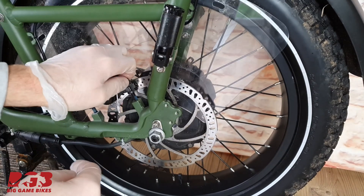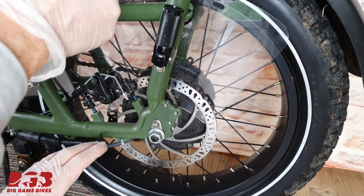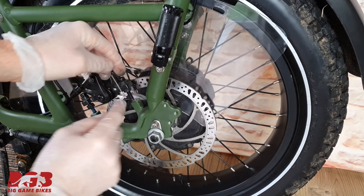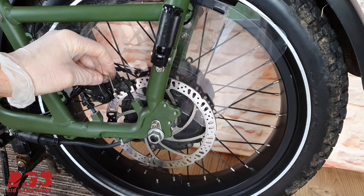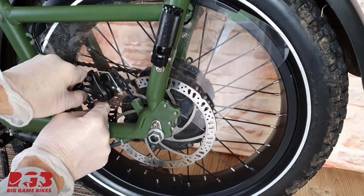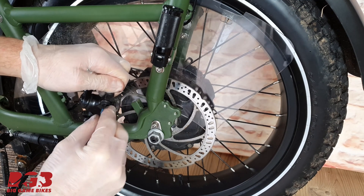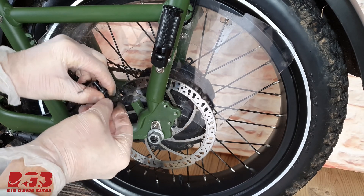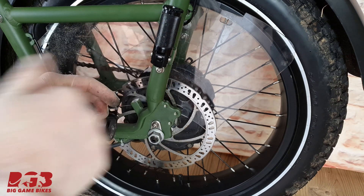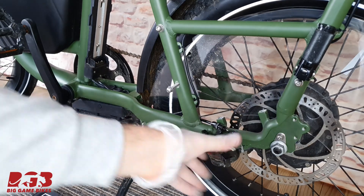I've removed the back panel just to make it a little bit easier to get into these four bolts. I've put some gloves on because this is a little bit of a dirty job. Now this is the really important bit — remember the washers? They need to come off the bicycle and go back onto the bicycle in exactly the same order. They're all holding together nicely, and that's the caliper off. Make sure you keep all of these in the same order. There's a little rubber washer that helps hold them in place — put them on the floor right by the wheel in exactly the same order they came off. Take your time, find all the cable ties that are relevant and with a pair of wire cutters just cut those off so we can get our brake removed.